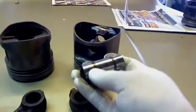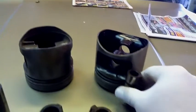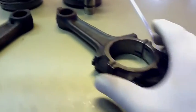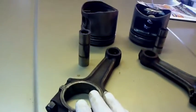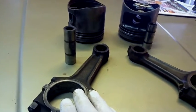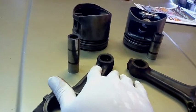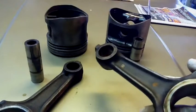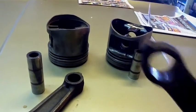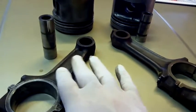The wrist pins were a tight fit still — no damage there. We have forged rods in both engines, the E30 and the E21. The rods are a little bit different — the E21 has an oil hole where the E30 doesn't, for some reason, just the one up on top. I think the E30 rod looks a lot better, even though it's a little bit smaller.